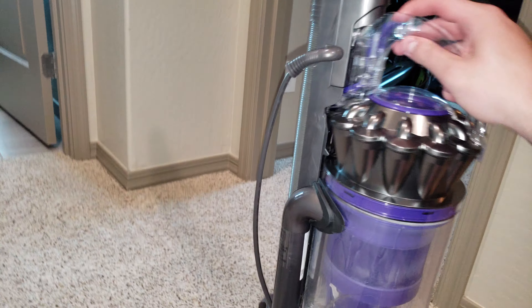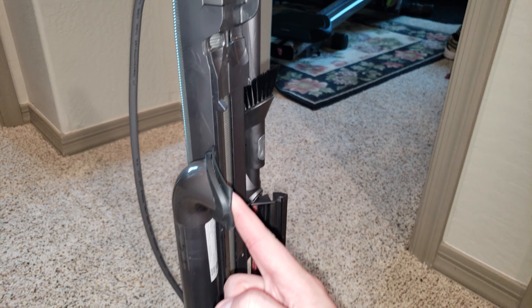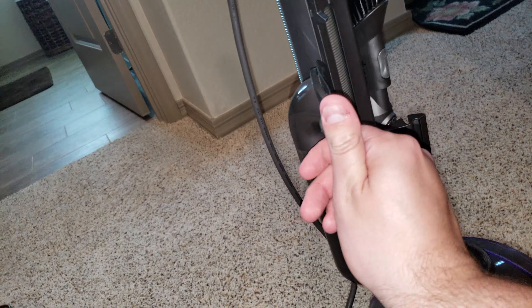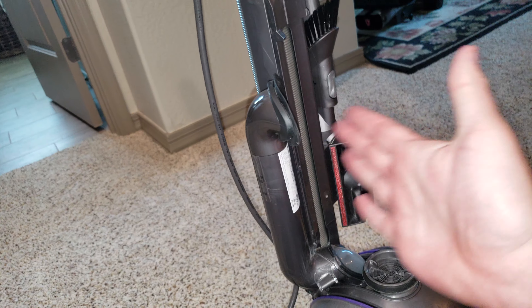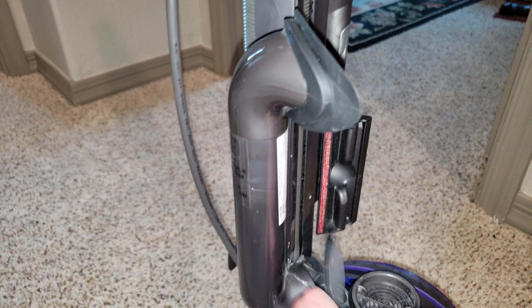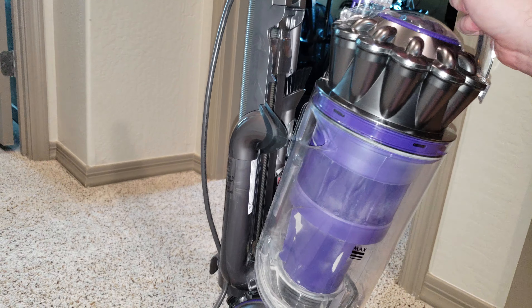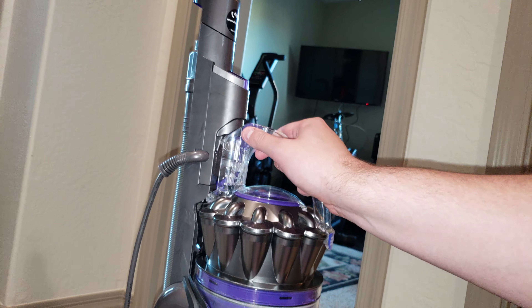Make sure that this seal is not bent inward. I've seen people where this seal is bent in — it gets moved and you lose suction power. Make sure it's out and make sure it's clean. If it's really dirty, friction from the dirt will cause it to bend in. Hold it out for a couple seconds and it should stay. This access point is also for your lower hose to get out any dirt.